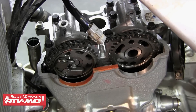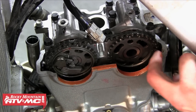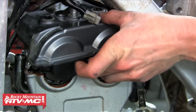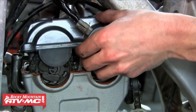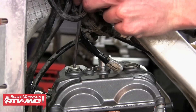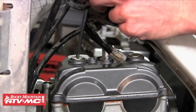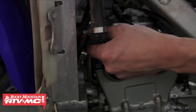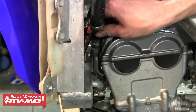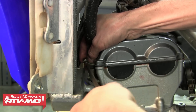The next thing we're going to do is apply a light coat of silicone to the cylinder head surface — that's going to help the valve cover seal a little better. Then we can just set that valve cover up into place. You'll notice we've already got the gasket on the top part of it. Then we can reinstall the two bolts on top and tighten those down. Once we've got those both tight we can just reinstall that top radiator hose down onto the spout coming out of the cylinder head and tighten that hose clamp down.